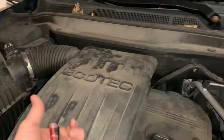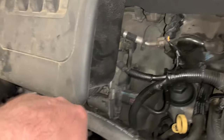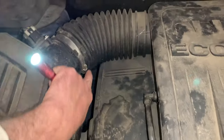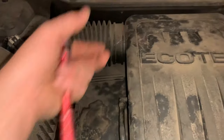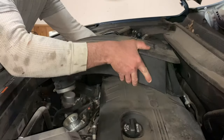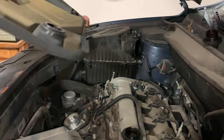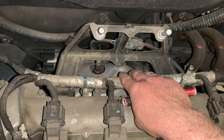To make things easier to get back there, I'm going to go ahead and take this air box off and probably the engine cover, see if that opens anything up for us. You just undo the clamp down there using an eight-millimeter socket — probably just pull it loose here instead of pulling the whole box off, take that snorkel off, and then you'll have your positive crankcase ventilation tube. Looks like that helped us a lot — you can really get down there and see what we've got going on.